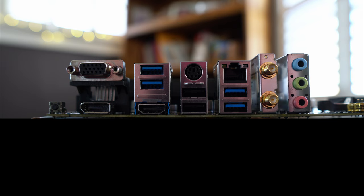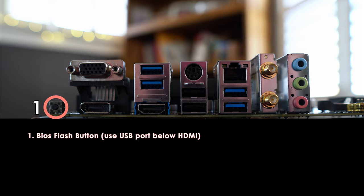As previously mentioned, there is a BIOS flash button. With this, you can download a BIOS onto a USB drive, insert it into the dedicated BIOS flash USB port — the one right below the HDMI port — and then push the button to update the BIOS. The great thing is you don't even need a CPU or RAM installed; you only need to plug in the CPU power and ATX connections. Should you do this before assembling the PC, you'll want to find out which BIOS version is on your motherboard. If there's no sticker or indicator, contact MSI's customer service with your purchase date and they should be able to tell you.